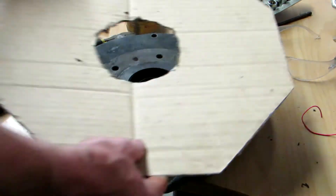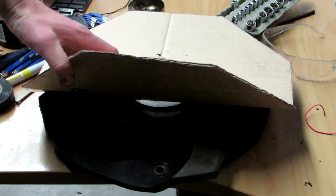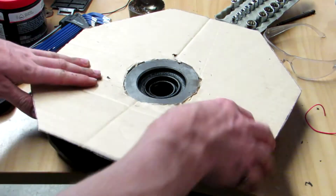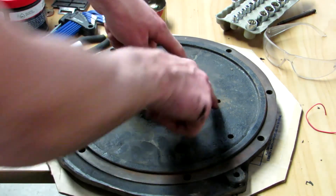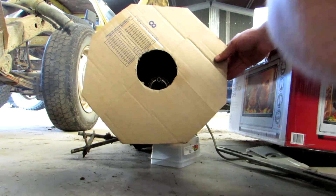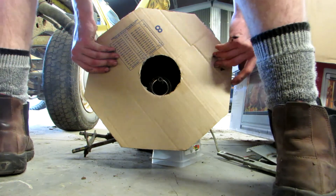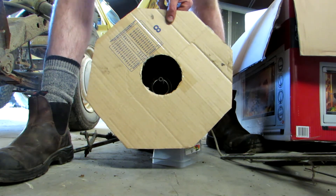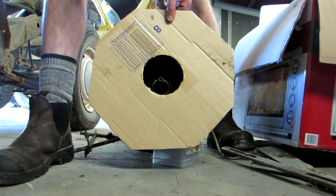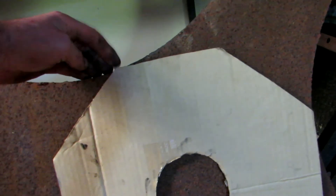This hole in the middle should fit straight over the middle there. If we line up one of the flat pieces down the bottom, we've definitely got plenty of room to mount all the holes — there's one there, there, there, there, there. Line it up where it's roughly in the center — there's heaps of room, it's going to be perfect. There is a little bit of starter motor housing showing, but we don't need to worry about that; it's not that important. Looking on here, I've only just really cut enough room — it's sort of just clipping over there, but it's not too much of a concern. As long as I can get them to use that middle piece right there, everything will be good.